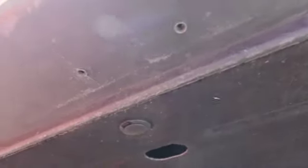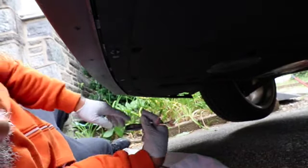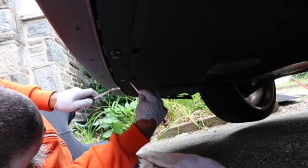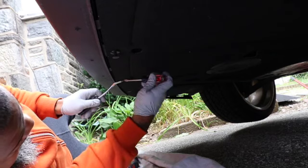Easy. You already see me take the ones off out of fenders. It's a little groove. You can stick the screwdriver in. Like I said, if you don't have a panel popper, you stick the screwdriver in there and just loosen it up and it should pop. You have to really work at them to get them down. Some of these seem hard to come down. I don't know why.